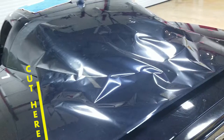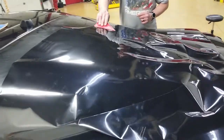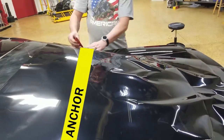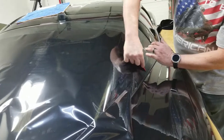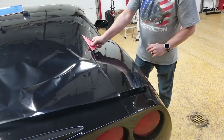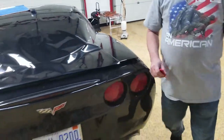We've got an older Corvette C6 here. First thing we're going to do is cut and leave the bottom long — we're going to cut this way on both sides. We're going to anchor right about 60% towards the top, leaving 60% of the film to shrink on the bottom and 40% on the top. You'll notice I'll lock down the top; the bottom not so much — I like to give it a direction to follow, but that's about it.